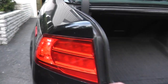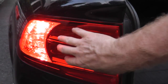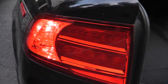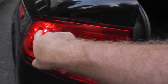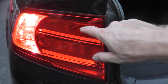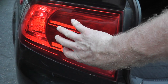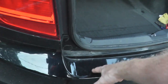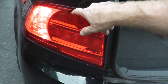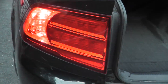The brake light is made up of two components. This section is an LED light — that's your brake light. This other section is your signal, which you can replace. The brake light itself is an LED unit, and if you need to replace it, the rear bumper has to be removed. I have a separate video showing how to do that — I'll include the link in the description. But for the LED brake light, you've got to remove the rear bumper.